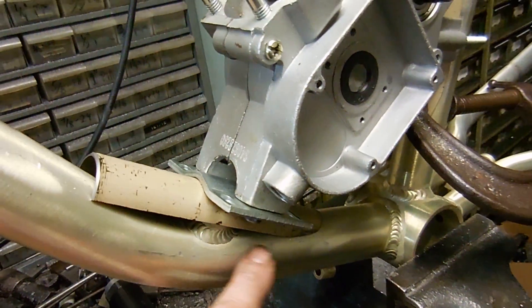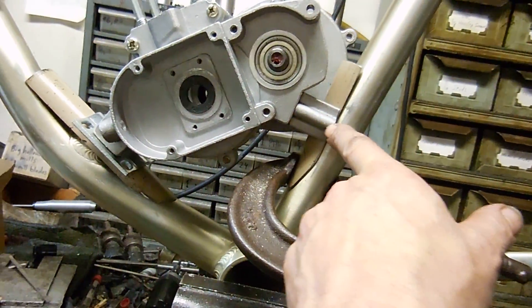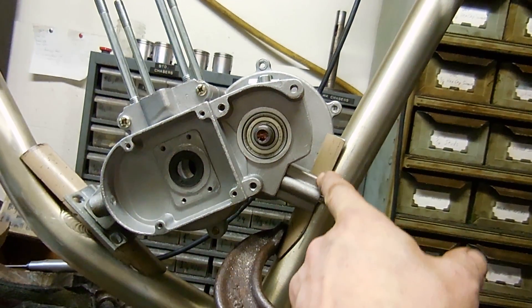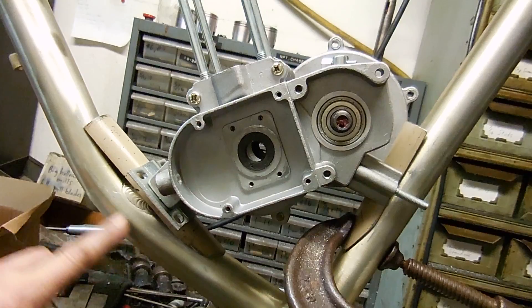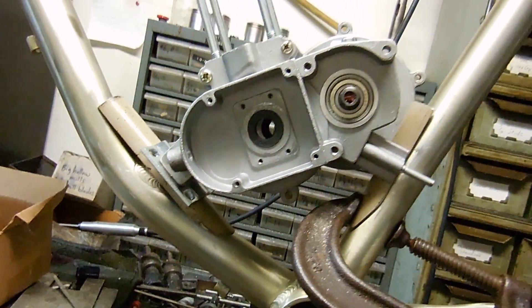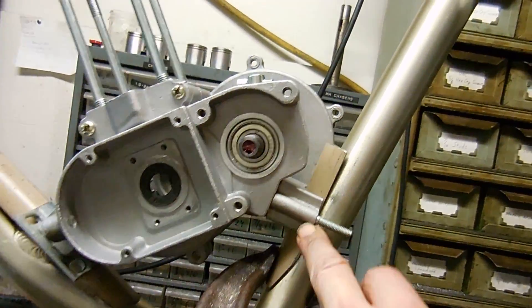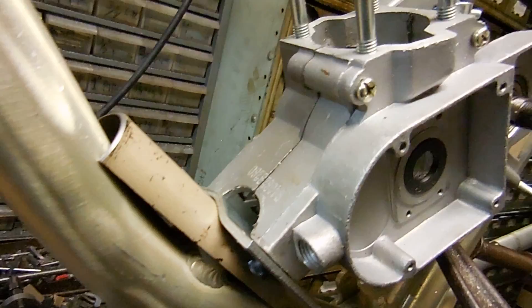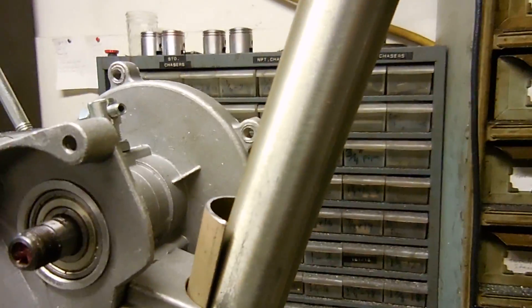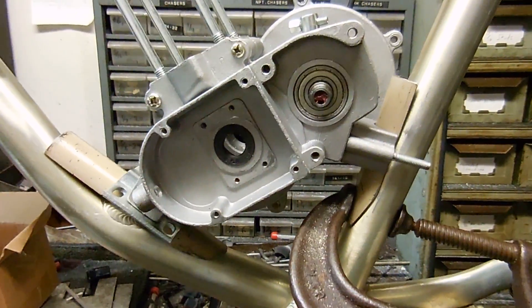What I'm going to do is seal this up, fill it with JB Weld with some filler. The angles were so off I had to compromise — I had to create a little bit of an angle mismatch for the seat post tube, and a little bit of an angle mismatch between the front part and the front mount. So I made the two mounts share the burden a little bit. Now I've got two nice steel saddles that fit the mounts perfectly, and I think it's actually going to strengthen the frame a little bit too, which should bring more reliability.